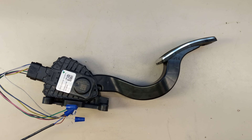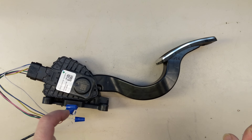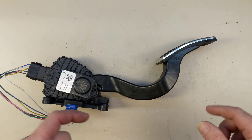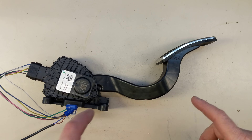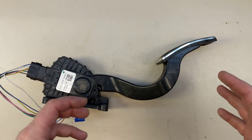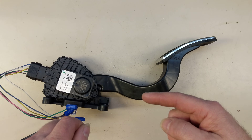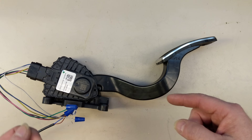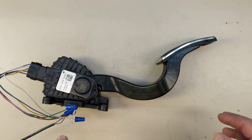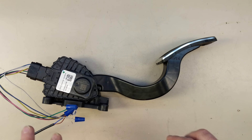So then they went to a Hall Effect system. The Hall Effect device is basically like a transistor that's turned on by a magnetic field — this is the same sensor that was in the iBooster, and there's a link in the description if you haven't seen that video. That was what was being used to sense pedal pressure, by varying the position of the magnet relative to that transistor to read a varying analog voltage. That's great, but they've since figured out how to get it even more reliable and cheaper.